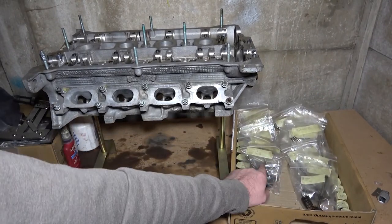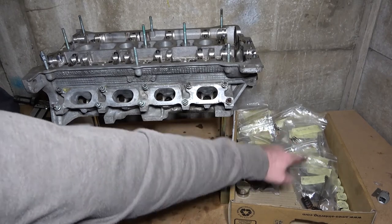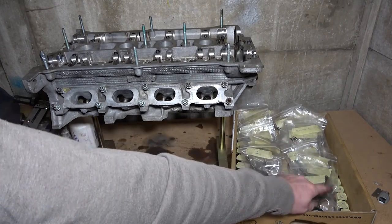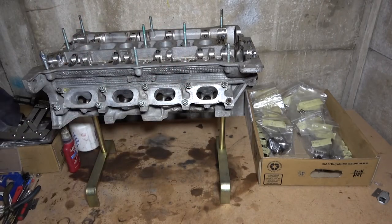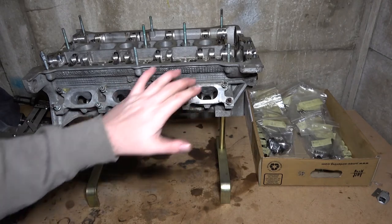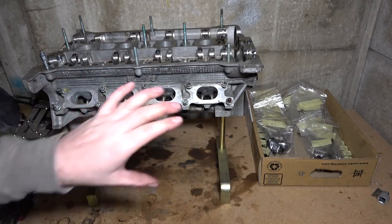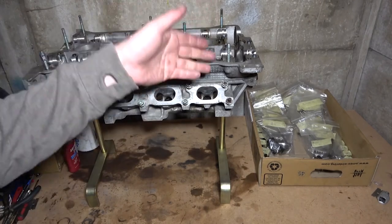As you can see, we now have all the buckets, all the exhaust valves, all the inlet valves and all the inlet buckets safe in the box. The head is now, for all intents and purposes — except for the bolts and cam cover studs — fully stripped. There is nothing left in it component-wise; it is just a big block of aluminium. Well, dirty aluminium.